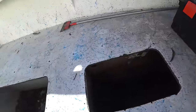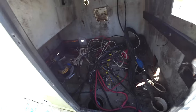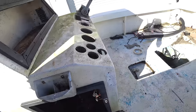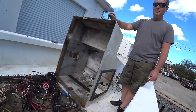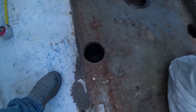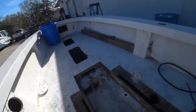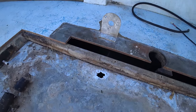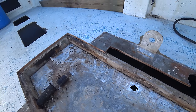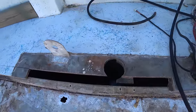Alright guys, this is my first time doing this with the video camera, but we just got the boat in for Rob. Check it out here. Basically what we're gonna start doing today is we're gonna get that floor and get that center console cut out and get the fuel tank going. As you can see we got some water floating in there. You can see one of the issues right here — there's a corroded hole in the top of the tank. Also, the boat was actually holding about 8 inches of water down inside the actual hull.